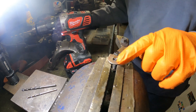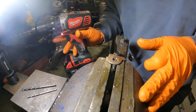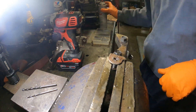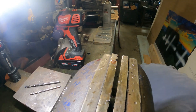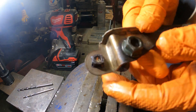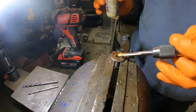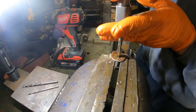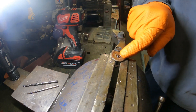So now all I'm gonna do is go through here, drill it to five millimeter, and get a six millimeter tap. Okay, you can see the hole. I'm gonna put a six millimeter by one tap through here — we're probably gonna pull up some of the old bolt. It's in there and it's turning, so we're gonna try and work that out.